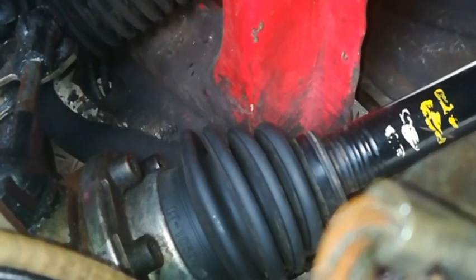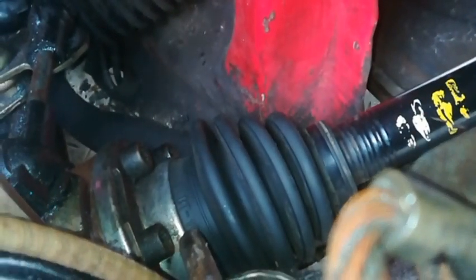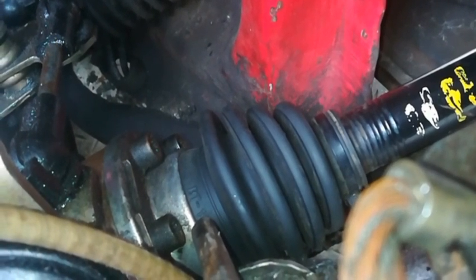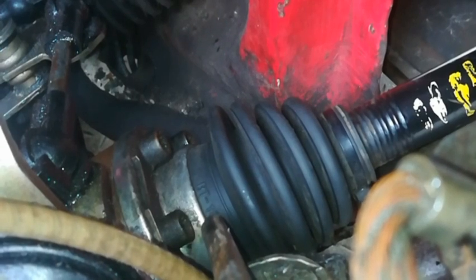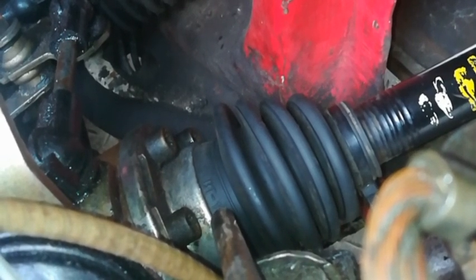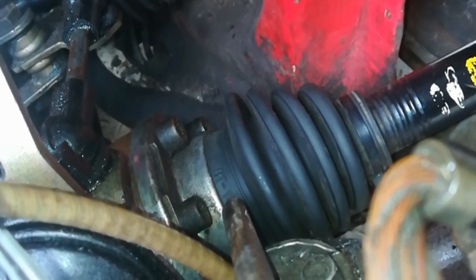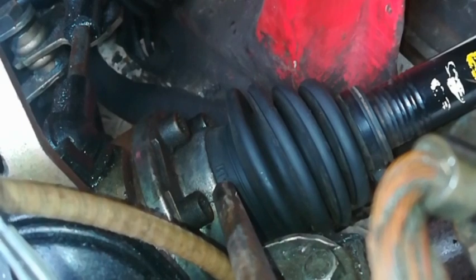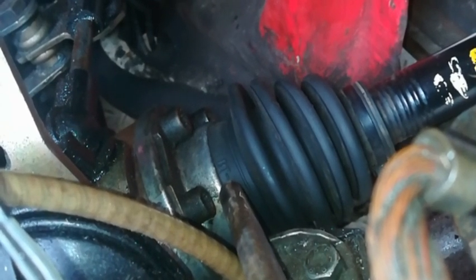Another issue that can cause vibration or shaking on your steering wheel is the bolts on your inner CV joint — there are about six of them. They can work themselves loose over time, causing vibration and shaking. That's why I always say get underneath your car and check these things. This can slowly work its way out and all of a sudden come loose and knock your gearbox. You don't need a lot of mechanical skills — just have a look, stick your Allen key in there, feel how tight it is, grab the shaft, move it around, and feel if it's loose.